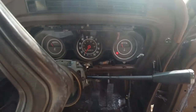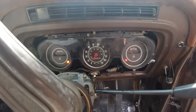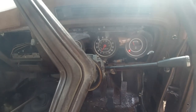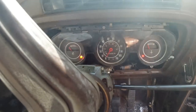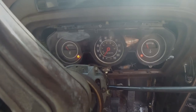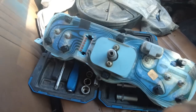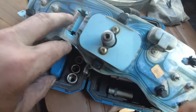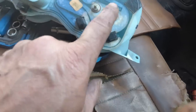We've got a long way to go to get that fuel through. I'm just annoyed about the gauge. Should, because normally even when it's empty it'll come up on the thing a bit. I'll have a little quick look at the plug now, be right back, but we've got to get this fuel through first. Let's check in the fuel gauge, and I've basically shorted the circuit out at the sender, so you'd expect a short on the input. In other words, a ground to the sender wire should give a ground to this, which would give you full movement, but there's no ground.